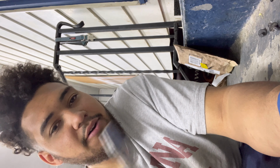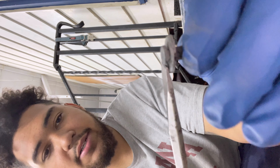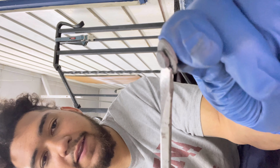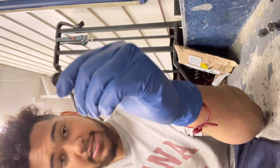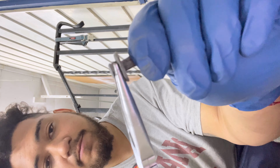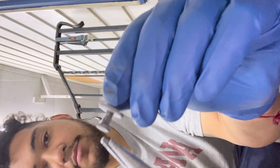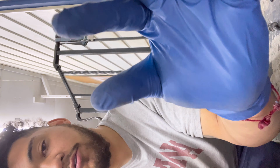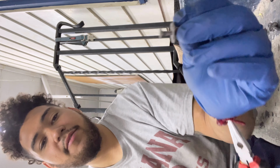Also, guys, if you're running into an issue with popping this rivet out here, I'll show you. You just take your flathead right up underneath the head there, wiggle, wiggle, and then it'll start to come up a little bit like that. Then what I did is I took my pliers, put them in the middle there, and just wiggled, wiggled, wiggled. And then it'll come to a point where it comes up like here, and then the whole thing will pull out because this is not designed to come out. So just simple enough. Once you got that off, time to take the light out.